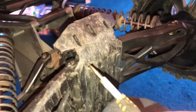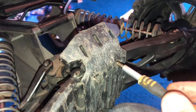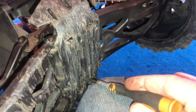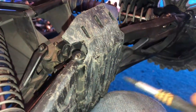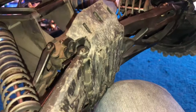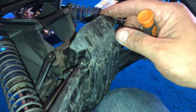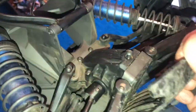Next, you want to undo these two bolts here. There are four bolts holding this plate on the car — that's the sliding plate, the bumper plate. You don't want to remove the whole thing, you just need to undo the front two ones, remove them, so that you can flip these and get them out of the way.